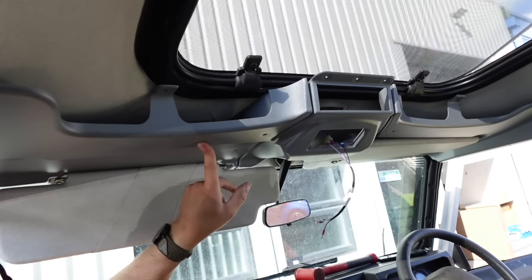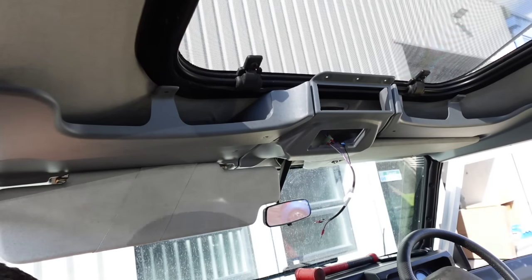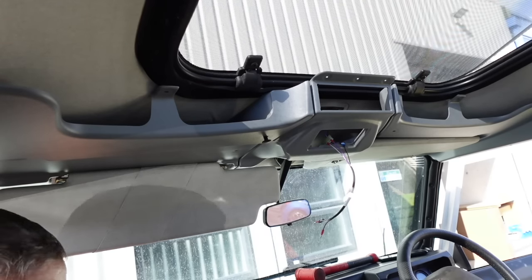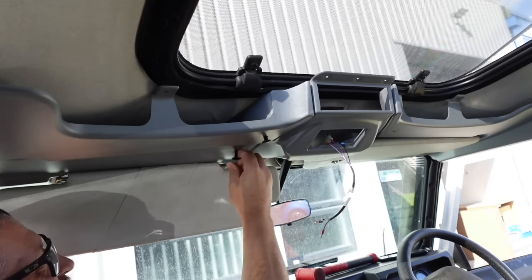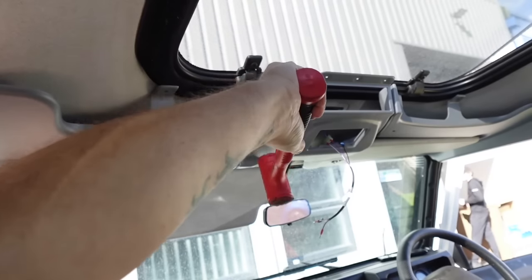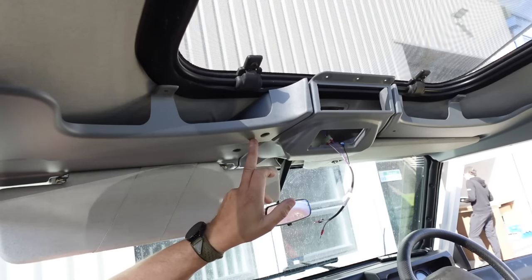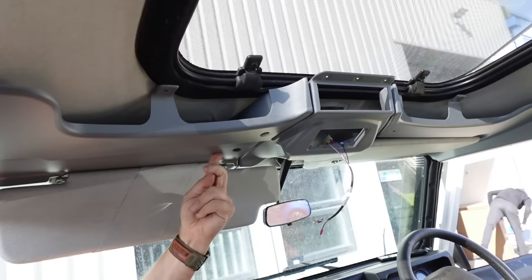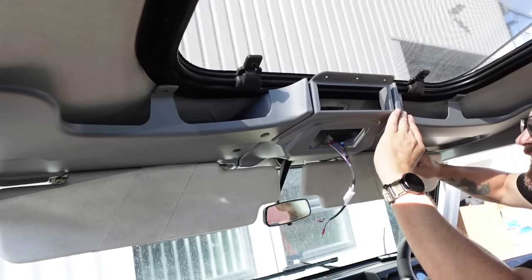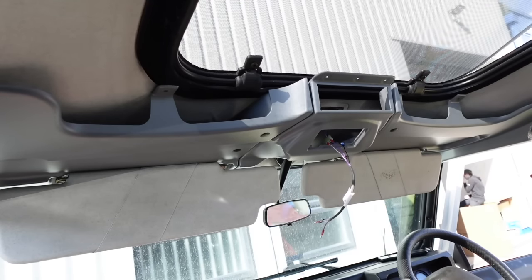It's all working nicely. Now we've got a couple more fasteners — you can see these two holes here, they need to be secured with more fir trees. Just watch as you're tapping them in because you can see them going in, so when you know they're nearly there just tap them home. A little extra bang and that is perfect. Dead blow hammer — definitely don't use a metal hammer, you'll destroy it.